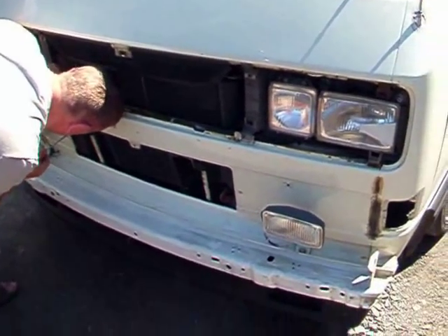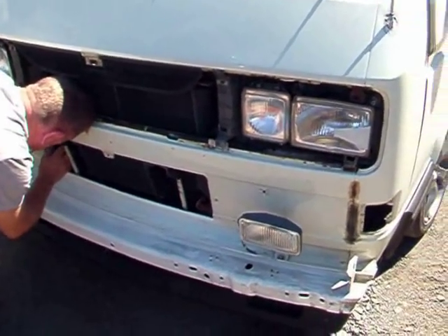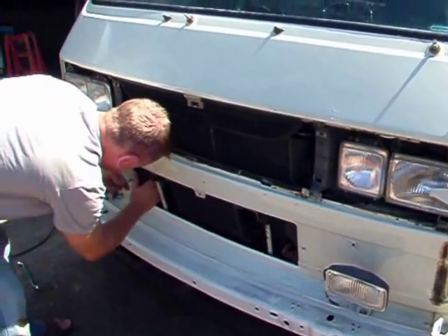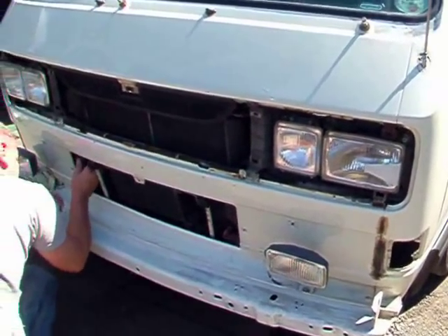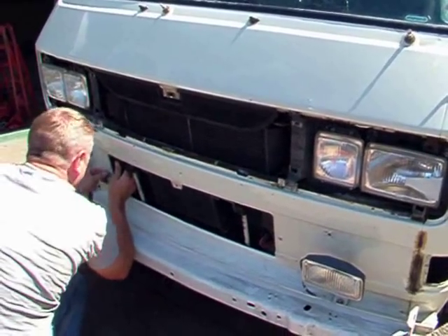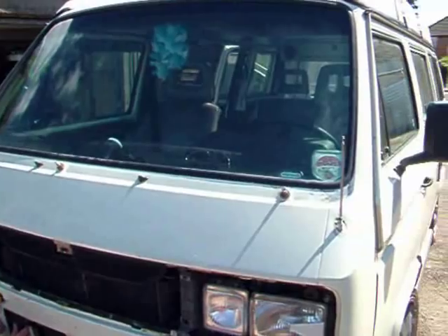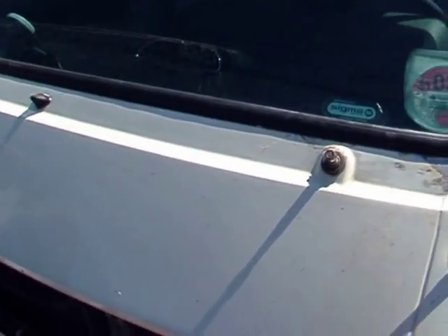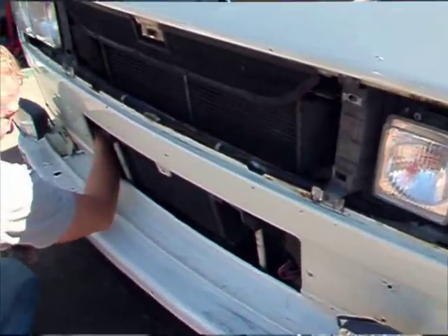What we're doing at the moment is basically stripping off stuff that would get in the way of the roller. In this case it's the two front spot lamps. Unlike spraying where you have to mask up everything, it's really just a case of running masking tape in relevant places so you don't get it around window rubbers and things like that — washer jets, windscreen wiper spindles, and all the rubbers off.